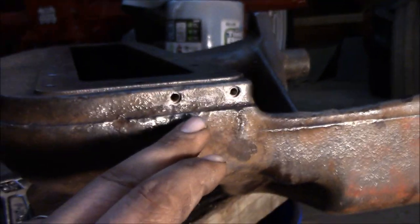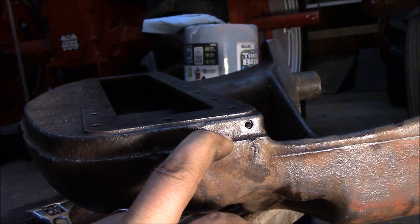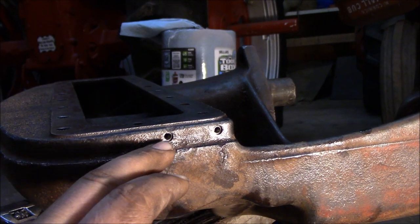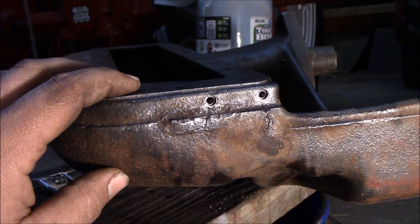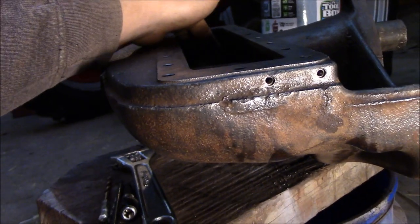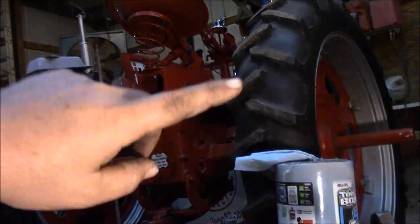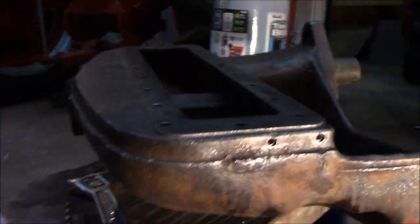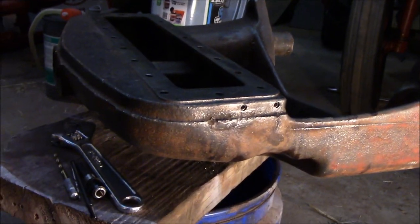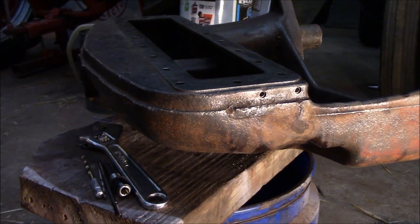These little bolts - if anybody knows about Cubs, you know about the front dog legs, and how those little 10-24 size screws, those flat-headed screws, for some reason they put in here tend to, when they've been in there a while - since this piece here gets pretty warm because the antifreeze is running through here - this is the bottom of the radiator, and your radiator hose goes in through there, into the bottom, and then up into the engine. And then of course you have the radiator sitting here. So this is what they call a thermosiphon system. Hot water rises, and that's how they use it to circulate and cool the engine. You have to have a decent amount of water in it for it to keep itself cool.